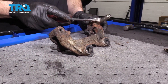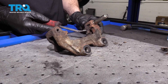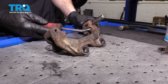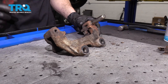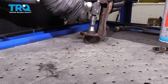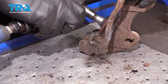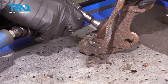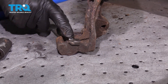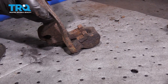Once you've thoroughly cleaned and inspected the entire slider pin, let's continue on to the four areas on the caliper bracket where those pads are going to need to sit. What I'm going to do is sand down this entire area so it's a nice smooth surface and then coat it with a little bit of lubricant. Here's a quick look at exactly where I cleaned — all along this ridge, over the top, and then down around there. I did the same on this one, and now I'll do the exact same thing on the other side of the bracket.